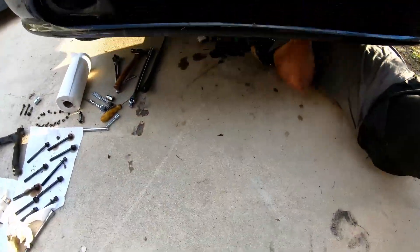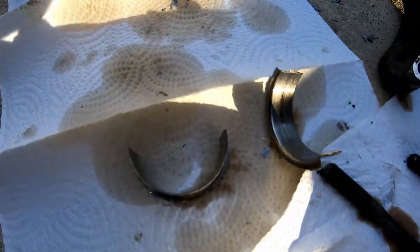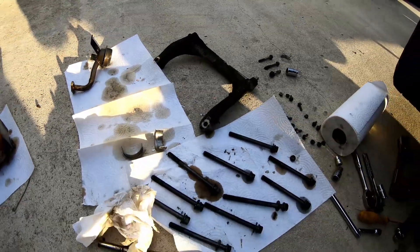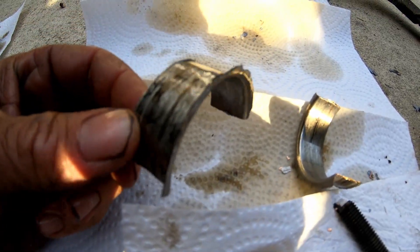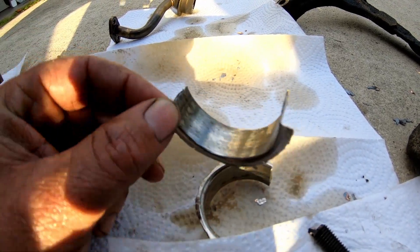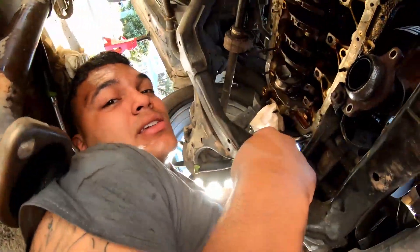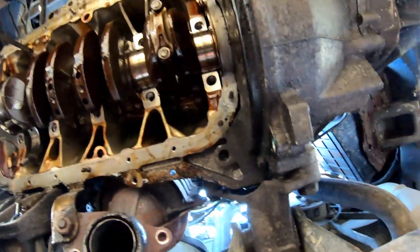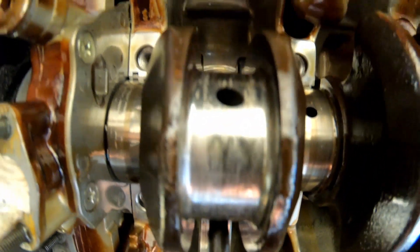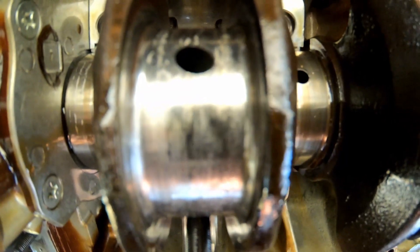We are back and we have some lovely carnage. We have all of these bits of metal that were inside the pickup tube. And here's what's left of the bearings for the rod on number one — paper thin. That's what's left. So what we have here is a pitted crankshaft for the number one cylinder that uncle rodney came and destroyed.